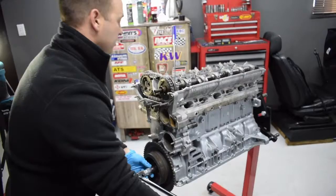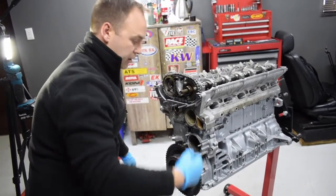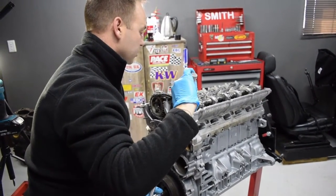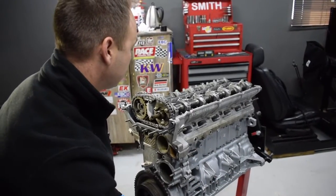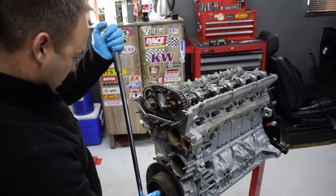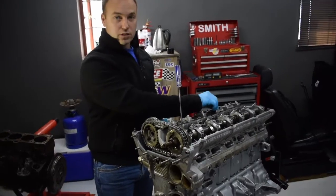There was no touch. Now in theory this is when the spark plug is igniting — that's going to push the piston down; the heat expansion pushes the piston down. It gets to the bottom of the stroke; as it starts coming up the exhaust valve opens, pushing all the exhaust gas out. It comes to the top and now the inlet valves are going to open — this is in theory when it will touch if it is touching. The inlet valves are opening, sucking air and fuel into the combustion chamber, then the valves close and it's coming up to its compression stroke, back to top dead center. Nothing touched — it would have been a hard stop — so nothing touched.